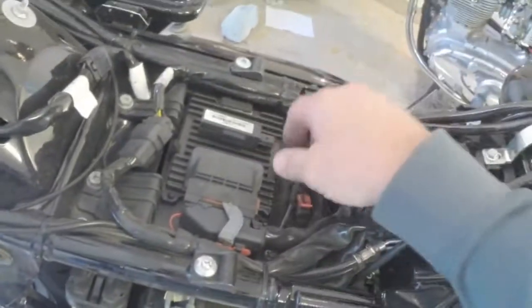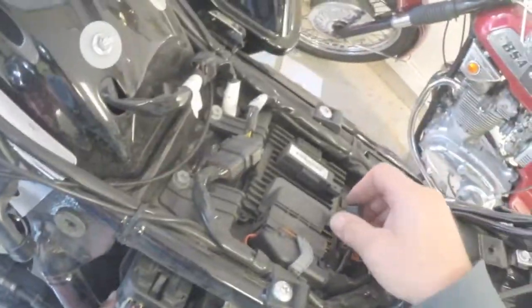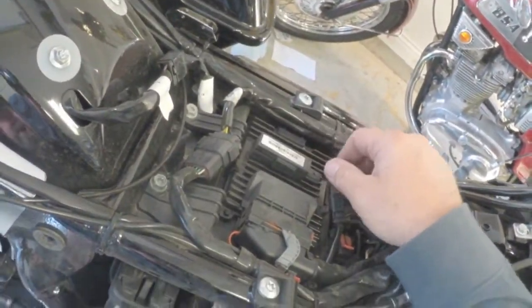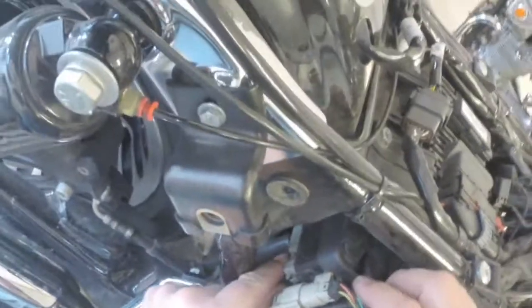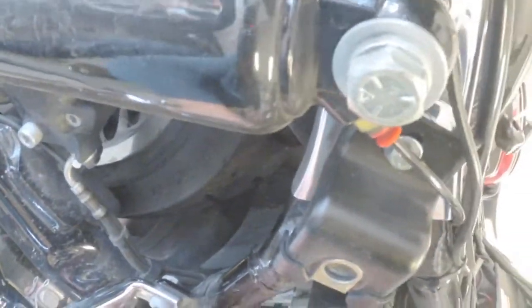What's tricky is the antenna cable. The error that I had — the 1145 error — said that the antenna was open. So that means the antenna itself could have a short in it, or the cable itself. I'm not a technician by any means; that's just what I'm assuming.